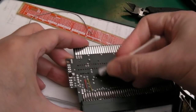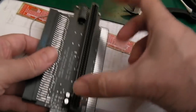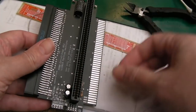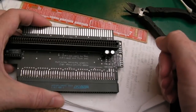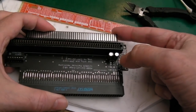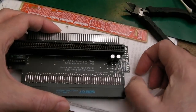And when I was explaining before, I was talking about current dips and things, it's actually about a voltage dip. You get a current spike. There's something on the card that's plugged in here, maybe you've got the A500 and a memory board or something plugged in here, or a SID card, and you can get current spikes as a result of some activity on the cards and things you're using. Maybe you've got a SCSI hard drive connected on it, that's going to create some pretty nasty current spikes, and your voltage could dip, and a voltage dip could cause some instabilities and things.